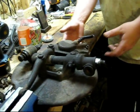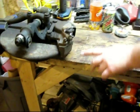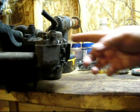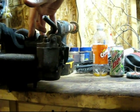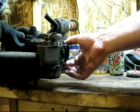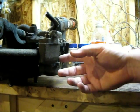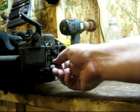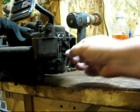And then right here we've got the disc brakes. Kind of take a shot on the angle on the side here. So it's basically just these two bolts right here need to come out. The two sides of these aren't meant to be taken apart, so the two sides of this stay together. And in here we've got our actual brake pads and stuff. There's just two pins that pop out here, and then these slide right out.